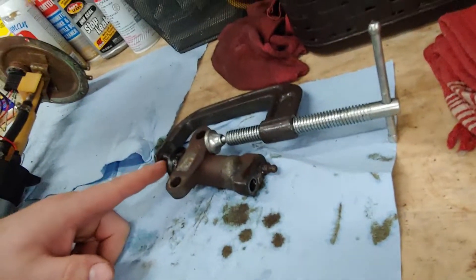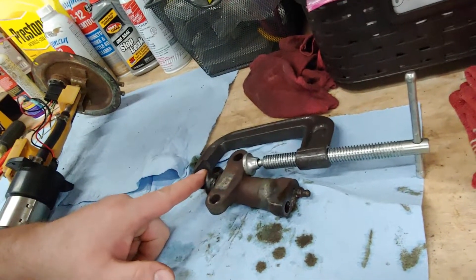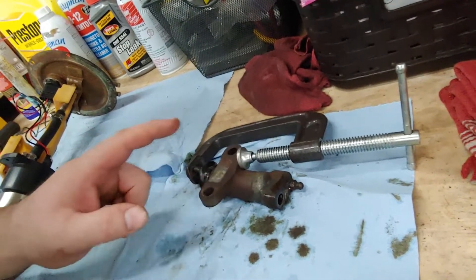But until then we're going to do some work on the clutch here. Like I said, I tried just doing the gravity thing — it didn't seem to work. So that's how I was going to show you what blocking was. Here's what that is — I got a C-clamp here, and you completely just depress it like this, hook it up, pump the clutch up, and you should be getting all the air out of it. Every last little bubble should be out of that slave cylinder because there's nowhere for it to go — it's actually compressed more than it ever would be in the truck. So you do that, hook it up, and then just bleed at the pedal, and you should be all set.